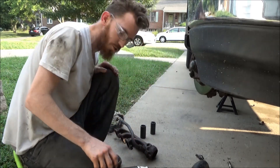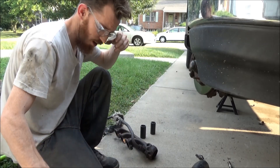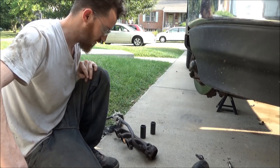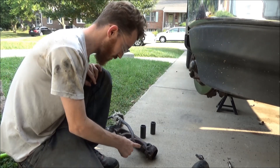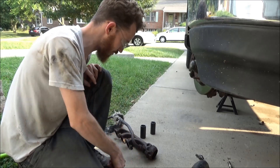I'm going to put a new one on there, and we'll chase those threads out and put anti-seize on it. I always put copper anti-seize on it. Now this EGR tube, we're kind of going to do the same thing, except I'm going to use a cut-off wheel and I'm going to cut this tube off.